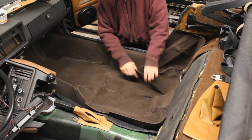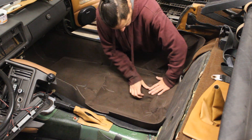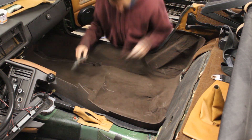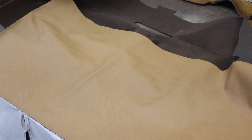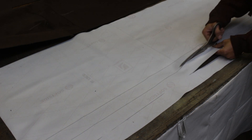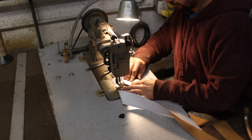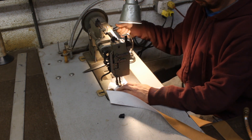It's the day after. I wanted to make sure the line at the side close to the sill is overlapping just enough the carpet piece already on the sill. It turned out the line was exactly what I wanted, so I cut it. Then I was ready to put binding on it. For the binding I had a piece of vinyl matching more or less the color of the interior vinyl on the seats, so I used that. I cut it into two-inch strips, then joined the strips on the sewing machine at 45 degrees so when I fold it around the carpet edge it doesn't become too bulky.